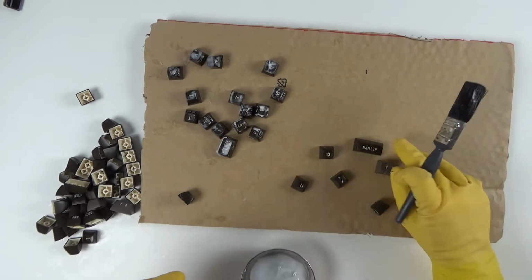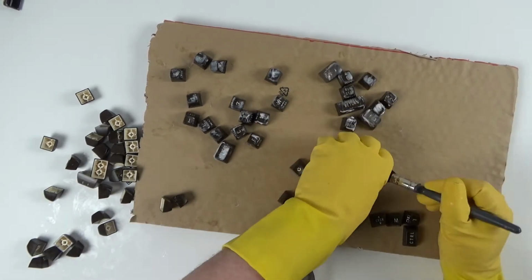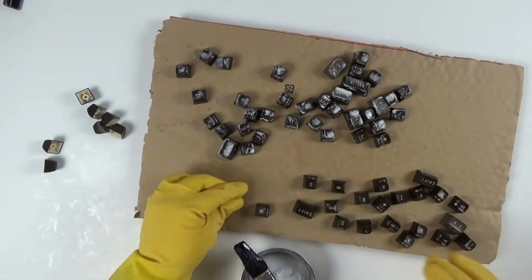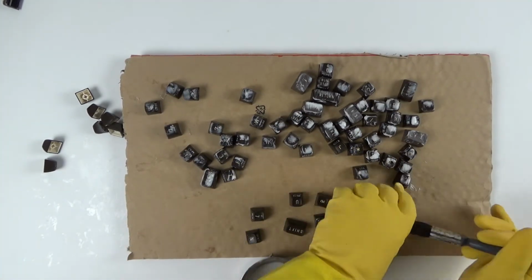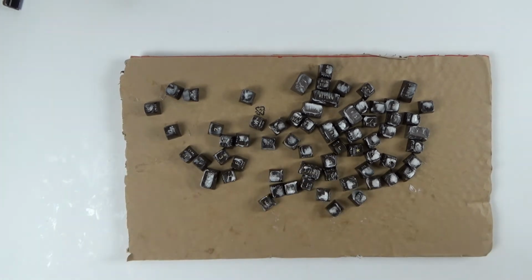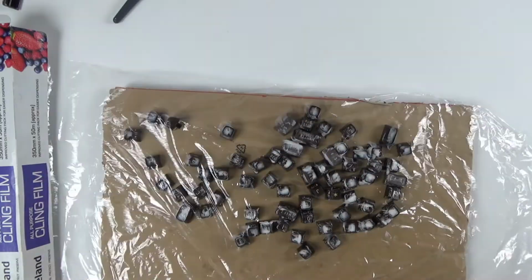As mentioned, the text is a little yellowed, so I'm going to put these to Retrobright just for a short while. Only the top part of the keys have cream on them, as that's where it's needed. To save time, I've not shown any washing of the parts after they have been retrobrighted. Simply rinse them off with water and dry them with a towel or air blower if you have one.